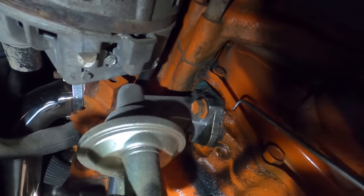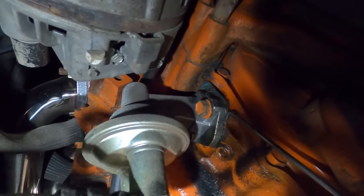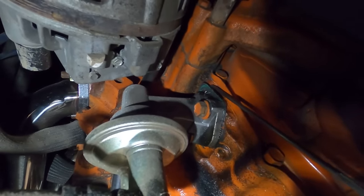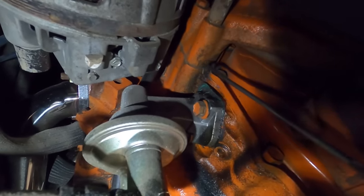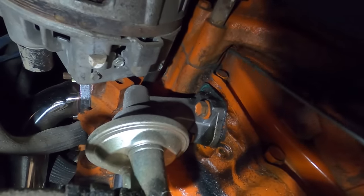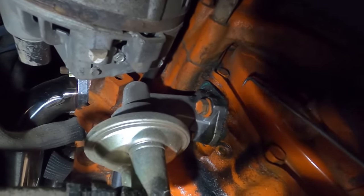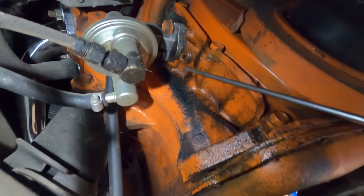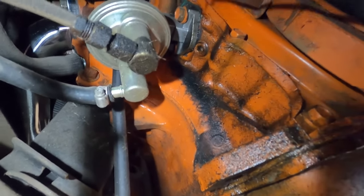But our oil leak is coming down right here out of the fuel pump. And you can see our fuel pump gasket. It's just kind of hanging out there. So apparently he replaced the fuel pump in the vehicle and was just playing around down in the dark, and didn't get the fuel pump gasket in the correct place. And that's causing this seepage we got going in here.